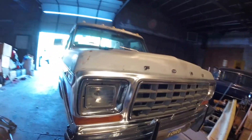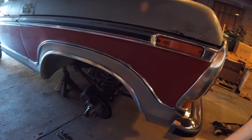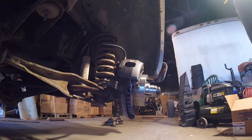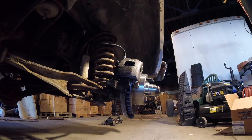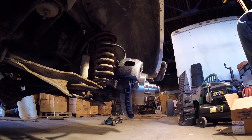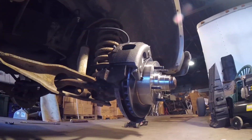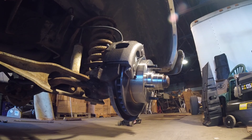So I'm going to pop those calipers off, get those rotors out of there, throw them in my trunk along with the brake pads, and try to get them swapped out. Just in case anybody watching is a rookie like me and not real sure how to take these calipers off — I've already got it mostly off the pin, but there's a bolt right here you have to take out; it fits in that little slot right there. Then you pretty much just knock that pin out.